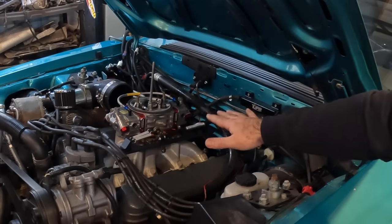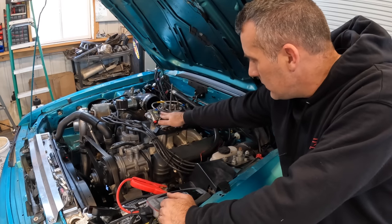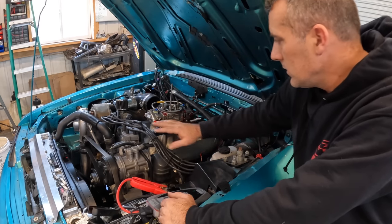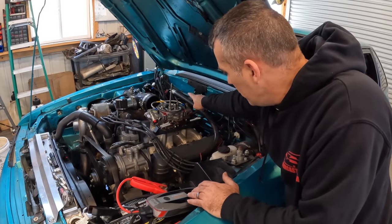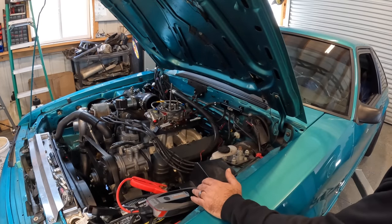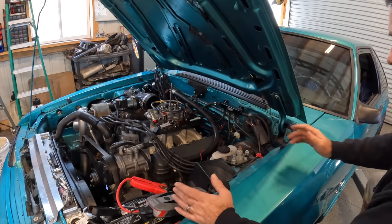So obviously we got way too much fuel pressure. So we may have a stuck needle in seat, because I didn't see the front bowl do that. So let me look everything over and then we'll go from there. Only thing I did was tap on the rear needle and seat adjustment back here, and it looks like it's fine. This carburetor probably hasn't been ran in a while, so let's check it one more time.